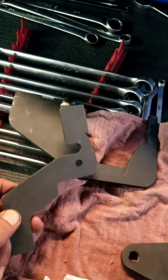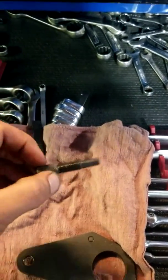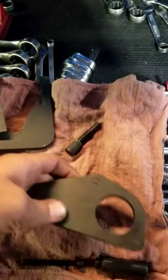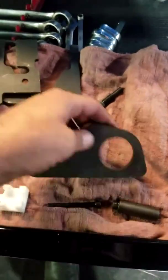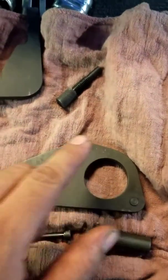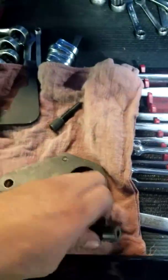This piece here is just to lock down one of the cams — I didn't use it because I had access to both. This is the plug for the crankshaft. Once it's in, you can turn it counterclockwise but you can't turn it clockwise. And here are these pieces for the crank sensor and the balancer and tone ring alignment.